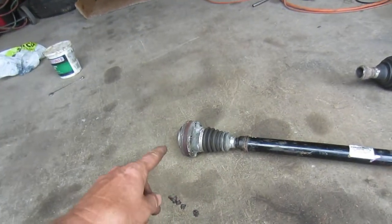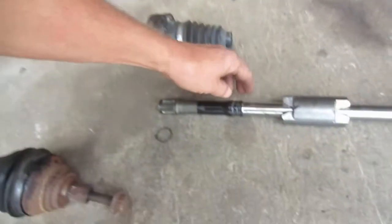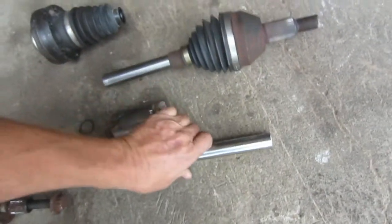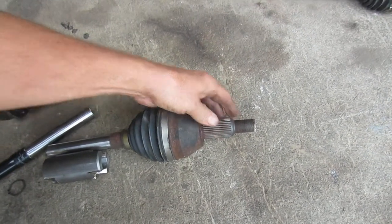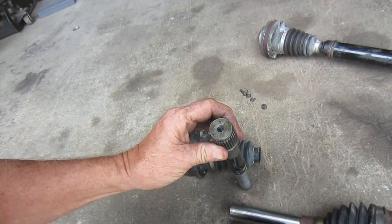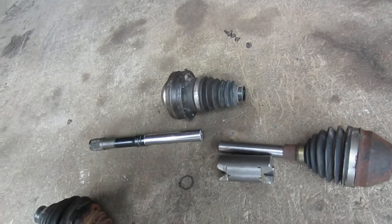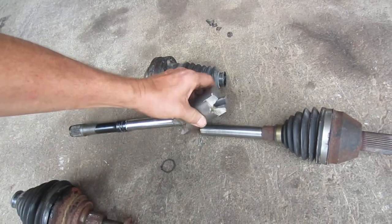You're going to use the inner ends for the VW because that's a VW transmission in there. These are cut extra long, but this end was put on the three-jaw chuck in a lathe — this used to be a lot longer. It had a center point put on the tail stock of the lathe and was turned between centers. This collar has a one-inch hole that's a precise fit so there's no wobble.